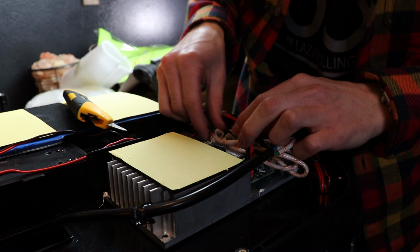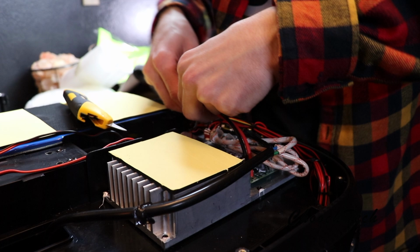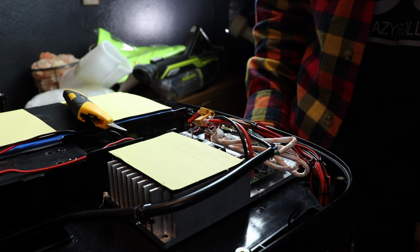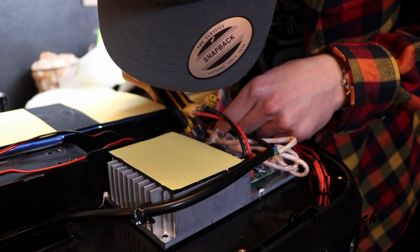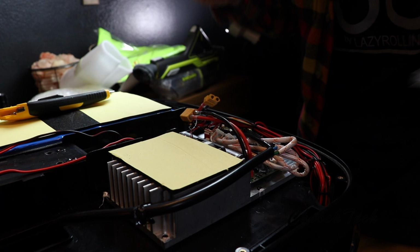And then first of all, we're gonna disconnect the battery. So disconnect the battery from the main board right here. And then what you're gonna wanna do is actually turn it on to drain it. So that dumps your capacitors completely, so nothing's gonna get surged or popped or anything like that. And then get in here, and you're gonna have to undo the silicone on this one little connector right here. Be really careful with doing it. An X-Acto knife usually works the best. So let's do that. This X-Acto knife right here.